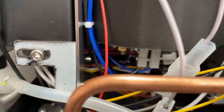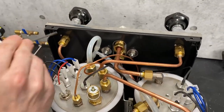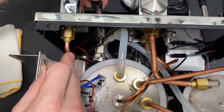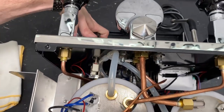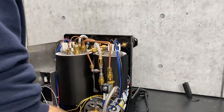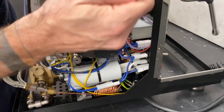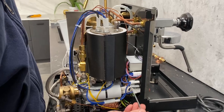Very hard to see — it's back there, we promise. That ends up over there — right up there. If you look straight down in here, this is your brew switch. That's activated when you lift your lever, which communicates to the board to activate your pump. We did briefly show you over here — this is where your PID is. You've got wires coming off the PID going to your NTC probes, as well as some other electronics on the other side.